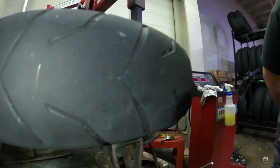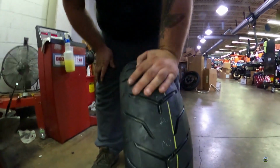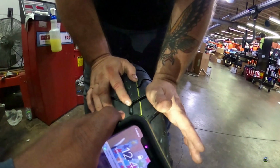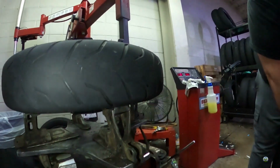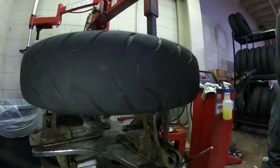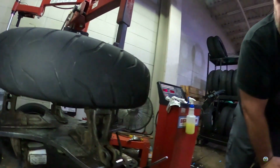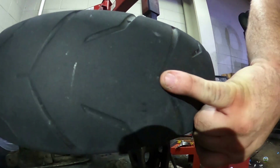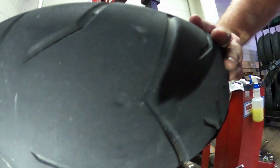Wow, look at this. What do you call that again? The tread. Oh, no, that little puncture thing? So there's a wear rib right here. Is there? Have I worn that out here? Yes, there's no wear rib in there. You were beyond the 2/32nds, which is well below the manufacturer's recommendation. Oh, really? Because this is kind of right there where you can see the wear. So this tire is not too much further from showing those things.